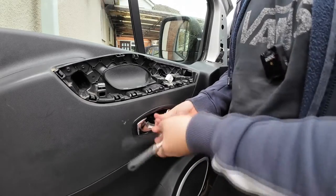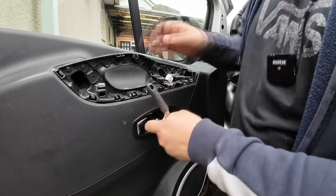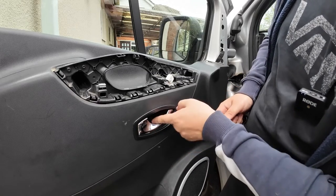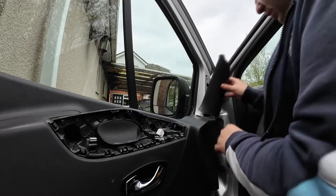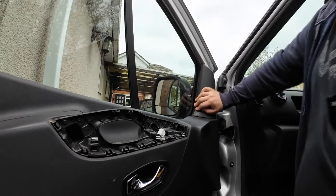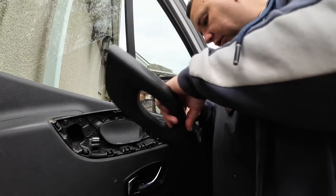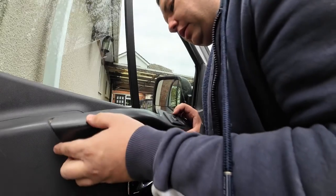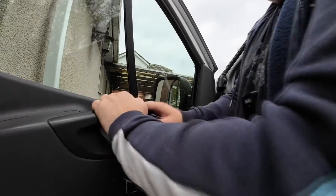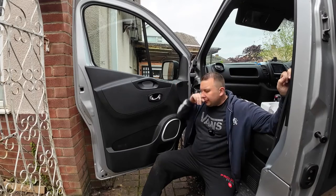These T27s you do want a little bit tighter because they're actually screwed into the door frame and you're pulling on these when you're shutting your door, so make sure they are nice and firmly in. Put the little trap door back on, stick the trim back on — just two poppers — that clips on like that. Then stick the window switch back on: the plug can only go in one way, and just give it a tap on. That's everything done — just remember to check everything works before you put all your tools away.